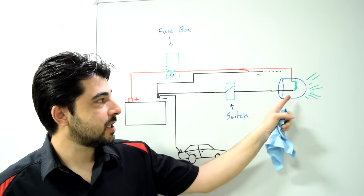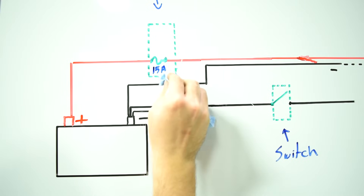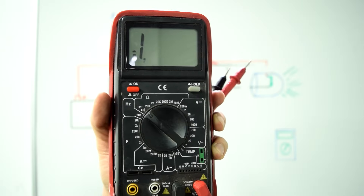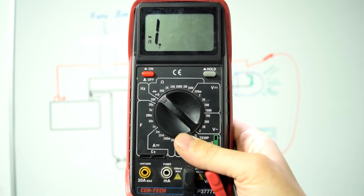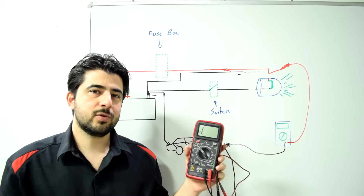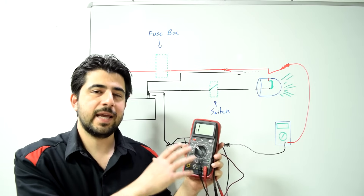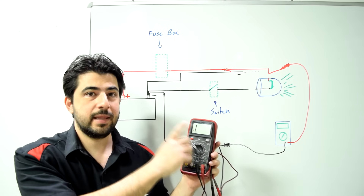You want to go to the connector for which the circuit keeps blowing the fuse, then disconnect the connector. Next, go ahead and remove your blown fuse as well. Grab your multimeter and set it to continuity. Put your black test lead on a ground — it could be a chassis ground — and put the red test lead at the wire. This way we're checking for continuity to ground on this wire right here. There should obviously be no continuity to ground, so what you want to see is a 1 or an OL on your multimeter, which stands for open loop. Those are the only two acceptable readings. If you get any resistance reading when you do this test, you have a short to ground somewhere in that wire and that's not acceptable.